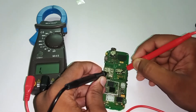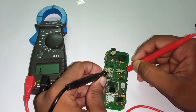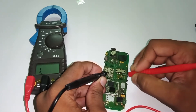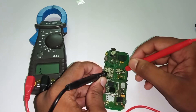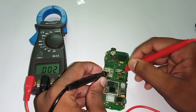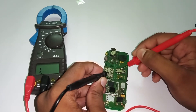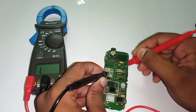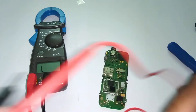This pin in Nokia phones basically remains the no-connection pin, so we don't need this connectivity. Next, and finally, it is the ground — so we have the VCC and the ground. But we don't have connectivity on the three middle pins, and that's why our SIM card is not being detected.